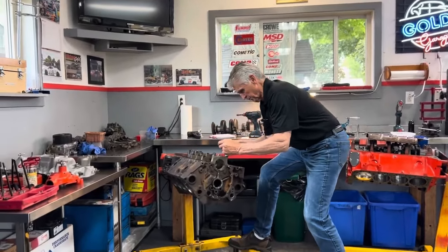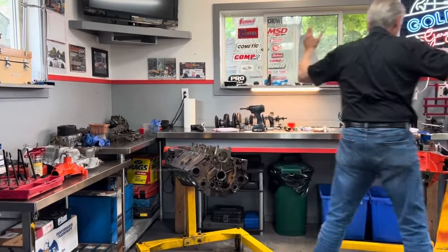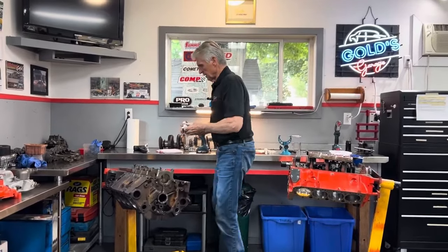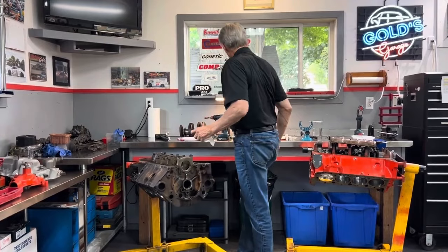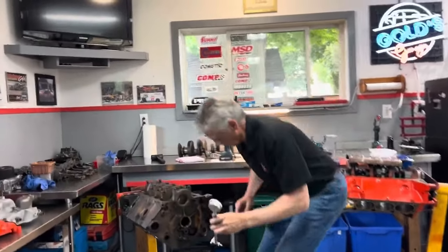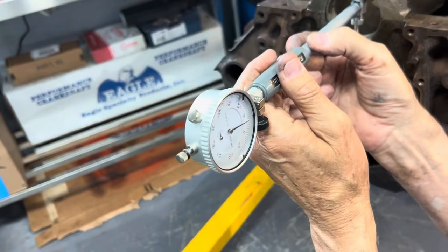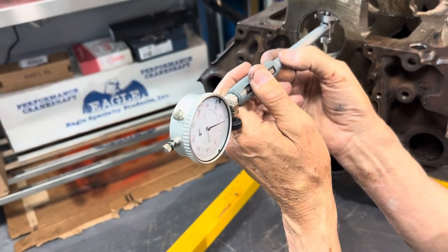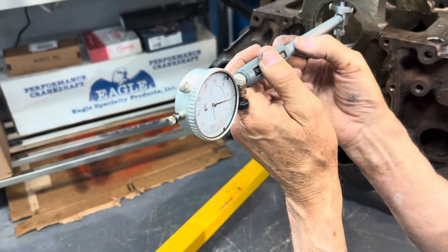Same thing — 80 foot-pounds, we didn't move anything on the torque wrench. ARP secret sauce is very messy. I used to think it was a moly of some kind, but I went back and looked at their website and they claim it's not moly — so I sure don't know what it is, probably no one else does unless you work for them. Here's our dial bore gauge — we haven't touched it. Let's see what results we get: 0.0032 — exactly the same.